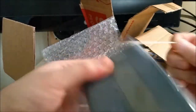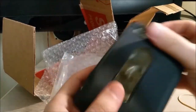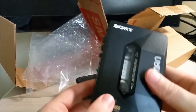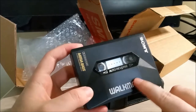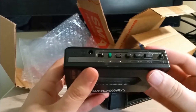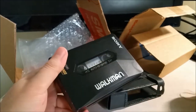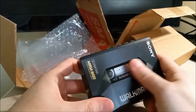I've been feeling a little retro, so... 20 internet points for whoever can name what this is already. This is a Sony Walkman tape player — a cassette player. From what I've read, there's a dent I'm going to have to push out here. I've read that this doesn't actually play; it makes motor noises but doesn't play, which is an infamous sign that the internal belt went out. We're going to see if we can maybe botch together some of these rubber bands just to get it working today.